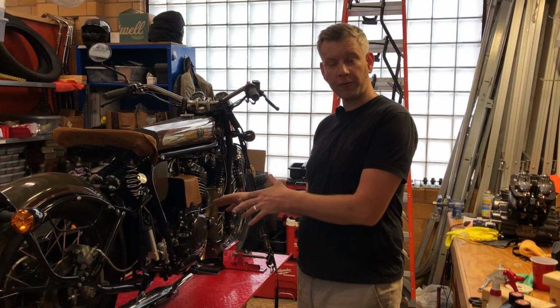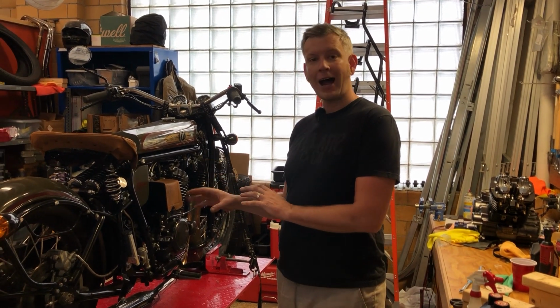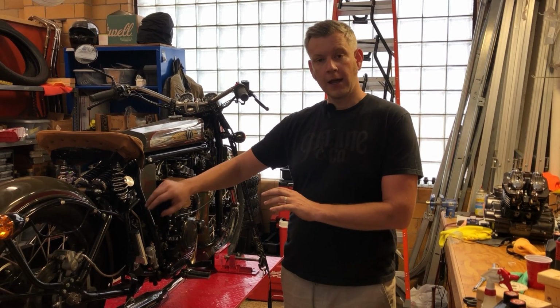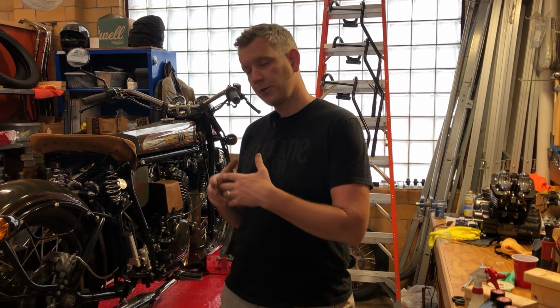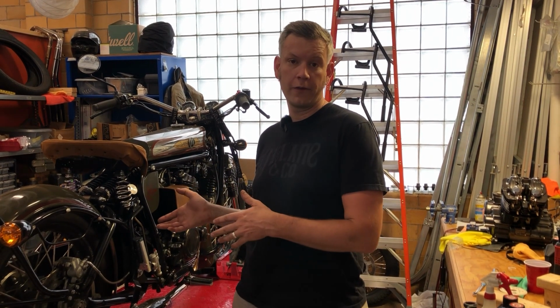On a bike like the 450, which is based on the XR400, it's a dry sump engine, meaning that there's an external oil reservoir or oil tank where all the oil is stored. The benefits of a dry sump system are that you can typically store more oil, which in turn provides longer life of the oil and a longer service interval. So you have a little longer service interval on the 450 than you do on the 250 because it's a dry sump engine.